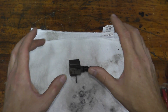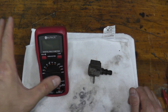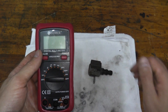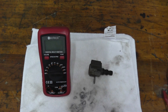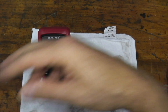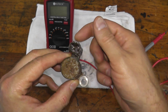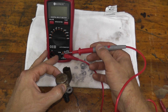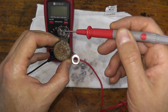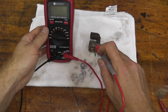There are two techniques we can apply to test this valve. The first is using a digital multimeter — an absolute must if you plan on doing your own auto repair. This one came from Amazon for less than $20, and you can do so many different tests on almost any sensor on your vehicle. The multimeter comes with a black lead and a red lead. Looking at the connection point on this valve, we have two prongs, and all we're doing is touching the leads to those prongs.